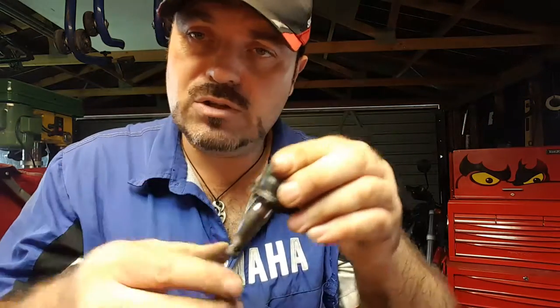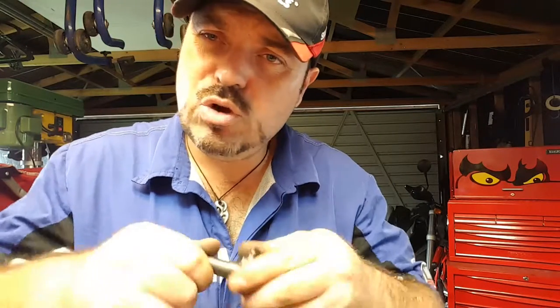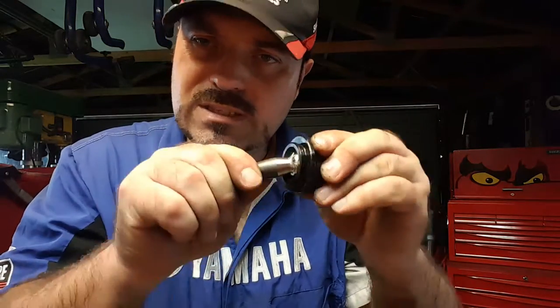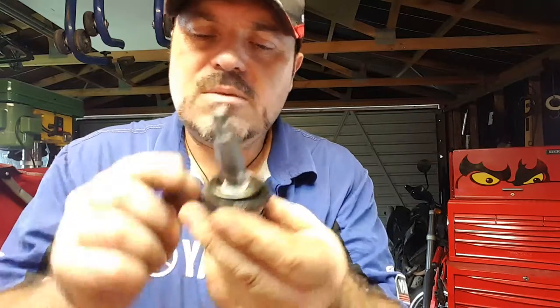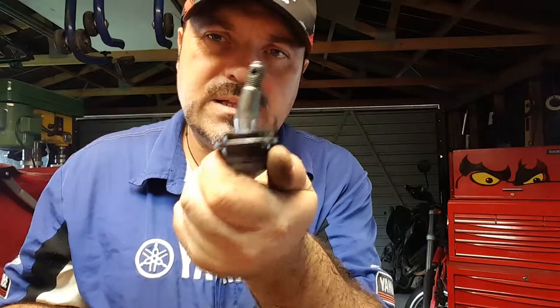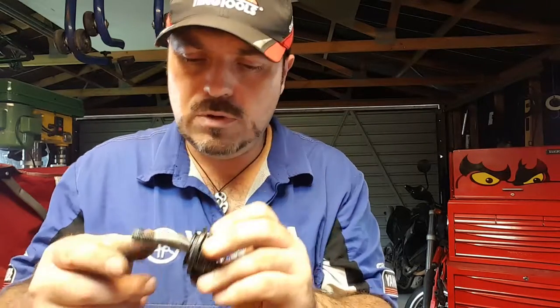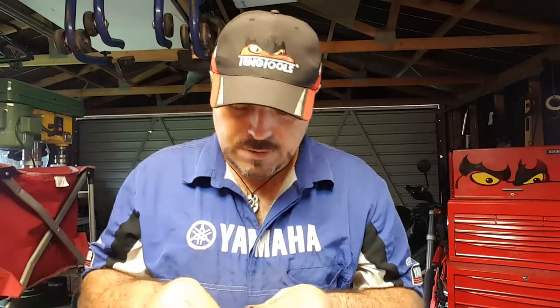And that's caused damage to where this taper goes into the knuckle joint, and of course it's destroyed this ball joint. Now sure, it's still pretty tight on the actual joint mechanism itself, that's pretty good. That wouldn't be a fail. But to take the boot off and actually have a look and see what's going on, that explains an awful lot as to what's happened to that wheel and why it had so much more camber than the other one. Because a small change on that angle would make quite a big difference to the camber.